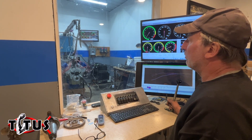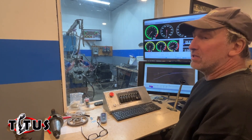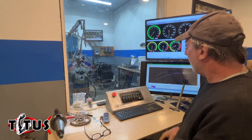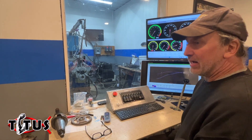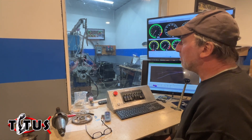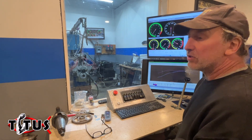The engine makes really good torque, it makes pretty decent power, but it doesn't really make as much power as it should. The limitation is the cylinder heads — they're heads that the customer has. They're not really good, they don't move a lot of air, and the engine basically just goes up and hits a wall and doesn't want to make any more power after that. We definitely have enough camshaft, we have enough carburetion, we have pretty much everything we need to make the power with the exception of airflow.